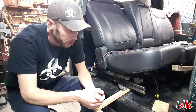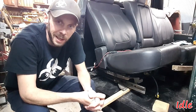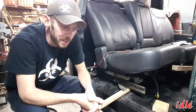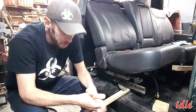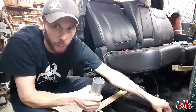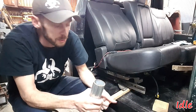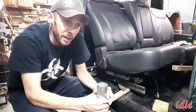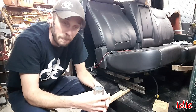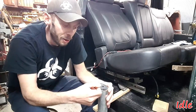So we're going to do something old school. At least it's old school for me. There's a lot of you in Canada that watch this, so I'm sure you're doing a similar version or know somebody that has with hockey pucks. What I'm talking about is taking a piece of pipe. We're going to cut it to length, and we're going to weld a washer on each end and just make spacers like that. I've done this before when I was younger and I was poor and couldn't afford a body lift kit. So we made our own with cutting pipe and welding washers, getting longer bolts.